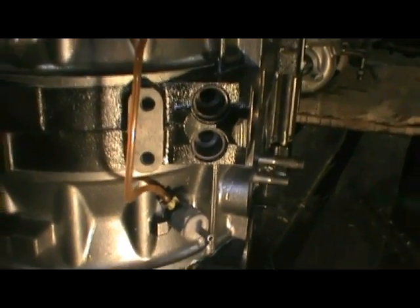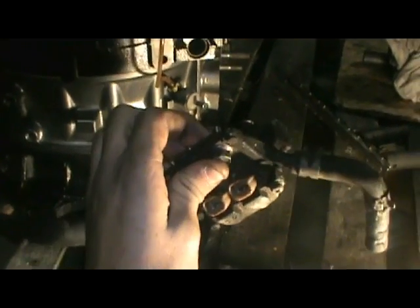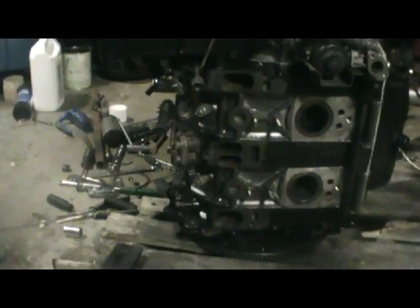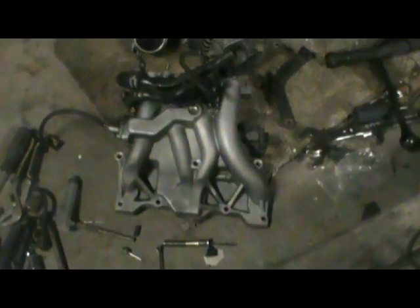The injector diffusers are in there and those little rubber insulators are there. I got this little spacer just on there — you can see it's just that black piece of plastic. Just about to bolt these on, I just wanted to make sure you guys saw that spacer. It's coming along pretty good, you can see quite a bit of stuff on there now and the parts pile is getting a little bit smaller. It's pretty much time to put the lower intake manifold on there, just about to get the gasket set up, I got it all clean.